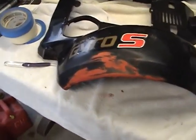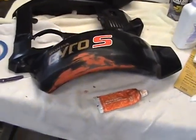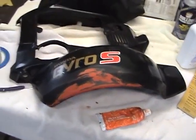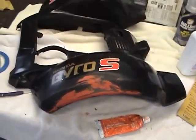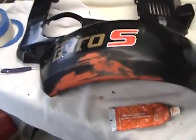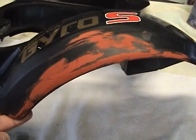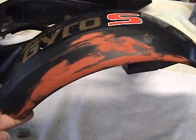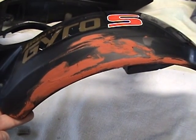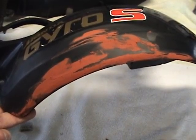Now I've put my first coat of spot putty on. Mainly, what they say is you can't put spot putty on bare metal because you need to prime it first — that's generally the way it's done. But we have to remember that spot putty is essentially a very thick primer with a lacquer thinner to make it liquid. When we put it on, it dries and we sand it. You have to always wet sand it — always.